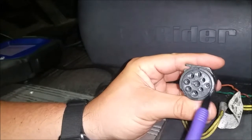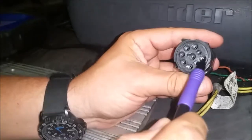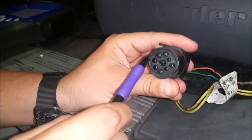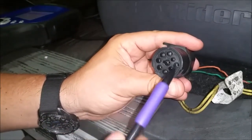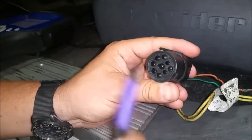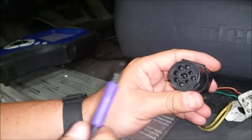What you can tell is if you look here, you've got this slot right here — this is your negative ground, it's the same on everything. If you look to the right of it, there's a 'B' on there — that's your positive terminal, it's like that on all these terminals. But if you look over here, there's no data pins here, but there's two over here. These two data pins are for the J1708 type of protocol. So this truck, even though it uses a Deutsch 9-pin plug, it's actually not a J1939 system. So when you're using your handhelds or computers you need to make sure you tell it to use the J1708 protocol.